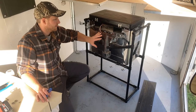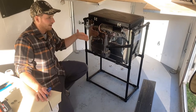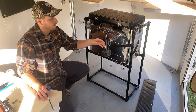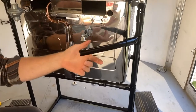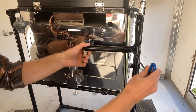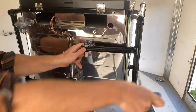Other than the four mounting points on the bottom, I did want to have something on the back, which is a little more difficult because there's some stuff back there — the copper tubes for the gas and the propane tanks. So I currently run a straight bar all the way across. I screwed on another one of these broom holder clips and then I just have a piece of conduit coming off one side so I can twist that in and tighten that connector. That gives it a little more rigidity forward and backward.